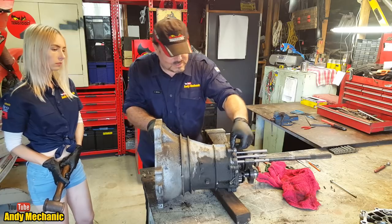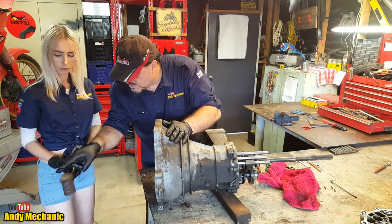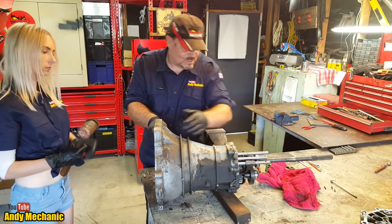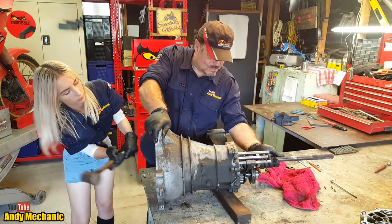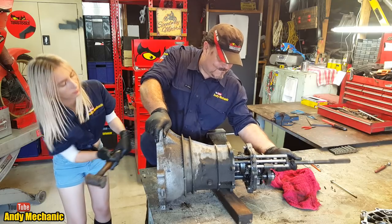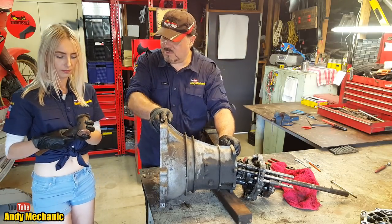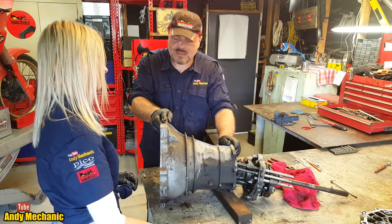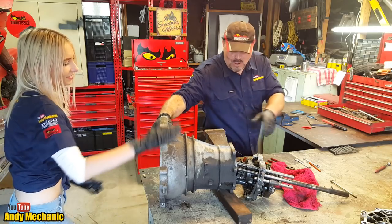Alright, Sam, you can see it's starting to split now. Look, we've got a bit of a gap going on. So if you flick your hammer around, so you're using the hide end, because it just takes some of the shock out of it, so we're not going to damage internal components, and give it some more wax. Oh, yeah. There's a cowhide, then. It is. It's a bit of moo cow. Works really well, though, doesn't it? Cheers, Mr. Moo. Right, you hold that for us.